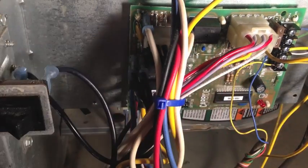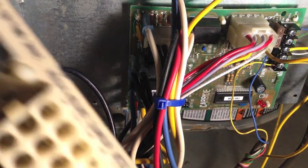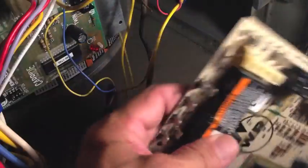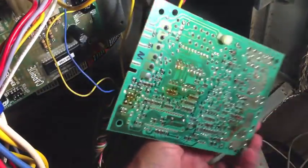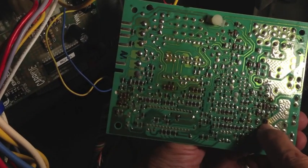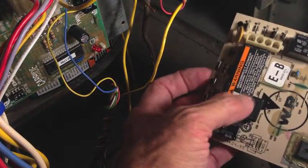Was the control board good? There are six little plastic clips that you can take off to access the circuit board, which is what I did. This is my old one. I didn't disconnect any wires to figure out what was wrong, but I was able to take those clips off all the way around, enough to see the backside of it. And when I got a look at the backside, I saw right down here — see that burned-out solder joint right there? That told me immediately: there's your issue. You've got a fried circuit board, right on the other side of what I believe is the fan relay.